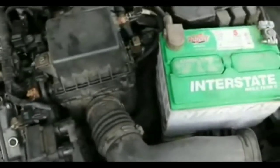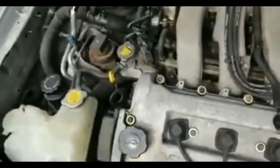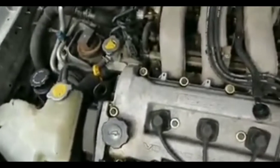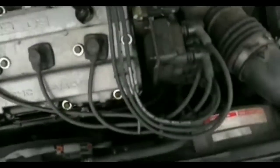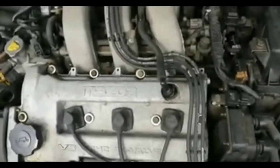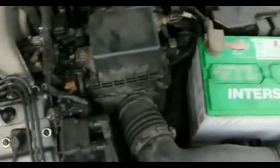They're good. So what I did next is I took a wire, I think it was a 12 gauge wire, and I hooked it up to the battery. And what I did was I tried putting it onto the little terminal on the solenoid, to see if it actually works. And nothing. So at that point, I knew that the starter was malfunctioning on this car.